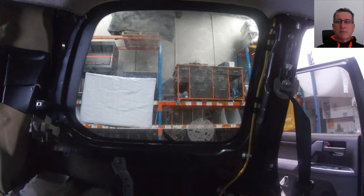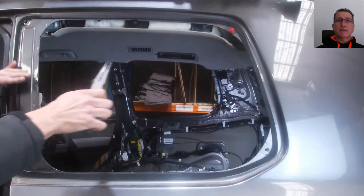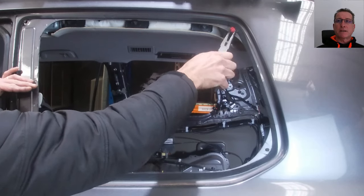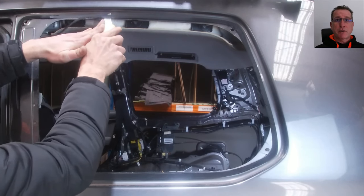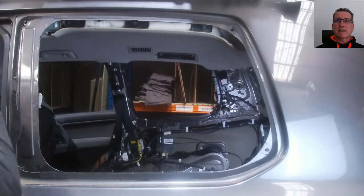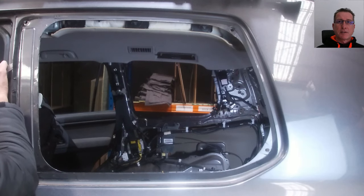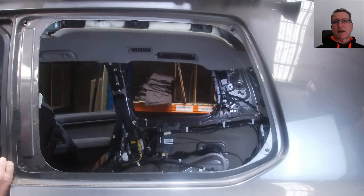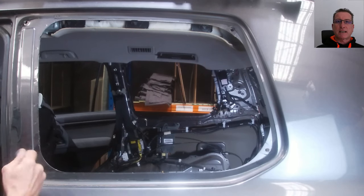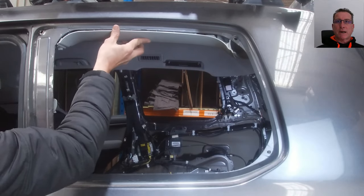The window is pretty much out — just a little bit of glue at the front to cut, and it's out. Now I just have to remove these little positioning clips from the factory and then cut back this glue. We don't need to fully remove it, we just need to cut it back — it's actually a great surface to glue to. Just be really careful not to do any scratches on the bodywork, so just take your time. The knife slices through it quite easily. We'll actually remove that front section later in the video just to clean up the install. So the glue's all cut back now.